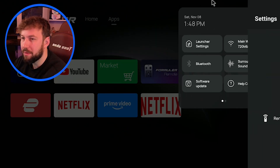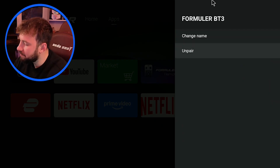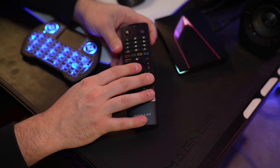Once you have control of your device again with the keyboard remote, head to Settings, go to Bluetooth, and disconnect your original remote — unpair it. Then do the remote reset using OK and the zero key until you see the blinking lights. After it's reset, do the Bluetooth pairing with OK and the three-line button. That might fix your problem. I've linked all my favorite keyboard remote models in the description. I always suggest having one in the house, especially if you have multiple streaming devices, so you always have a backup if your remote goes bad.